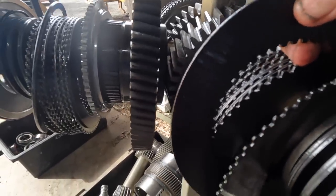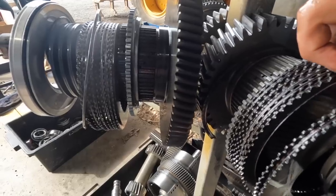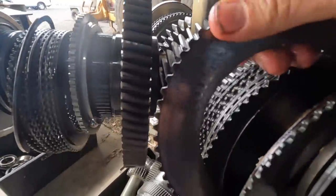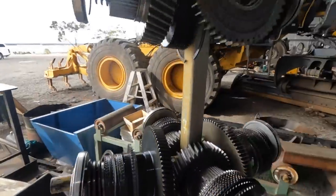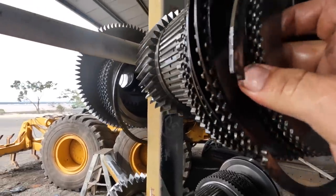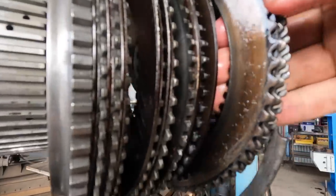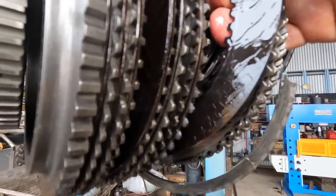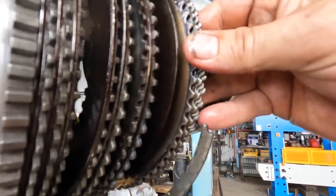And then you got your disc washers, disc plates, and they, oh, it's all sticky. Righto, and all that, you can tell there's no wear. They'll get hot. So up here, if I can find a crook one, I'll see that one's really dark, which I'll go this way in the light. Sorry, you can't see. You see that one's really brown, and that one, well, that's actually a clutch pack. So yeah, that one's very much stuffed.